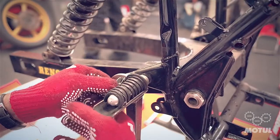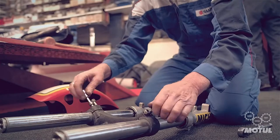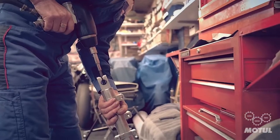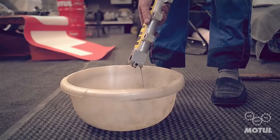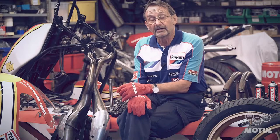On this one, we did a repair during the racing history of this bike, which was the reason why we had to use heat to remove the left-hand footrest boss. We've also disassembled the front forks — everything looks okay inside there. They'll be cleaned, reshimmed, and revalved to standard; just restoration work will be done on the front forks.